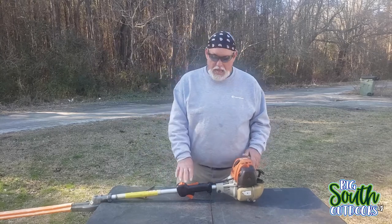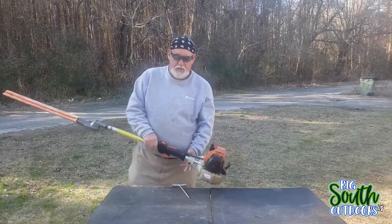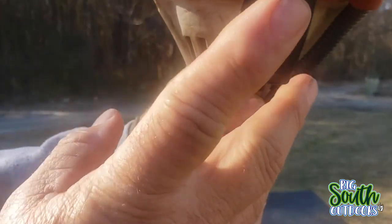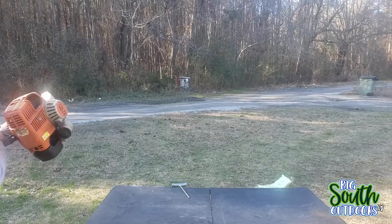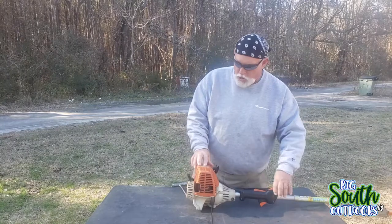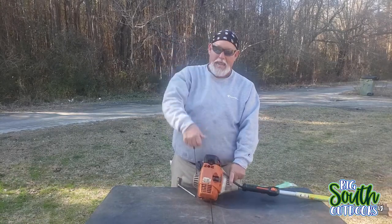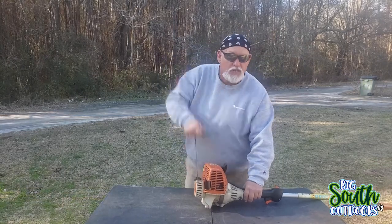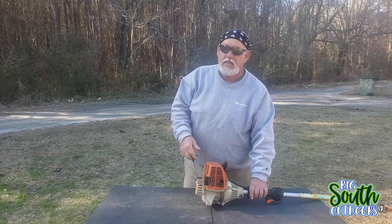Let me show you exactly why I had to go to the dealership. I'm going to take the spark plug boot off - the spark plug is still in the cylinder, so it is not spark plug-less. Let me show you why I had to go. When you pull the rope there's no resistance on it - I'm going to put one fingertip on this. That's bad - there's no compression on this whatsoever. Now listen - hear that clicking noise? The piston is moving up and down, but I don't know what that noise is, and that's not good.